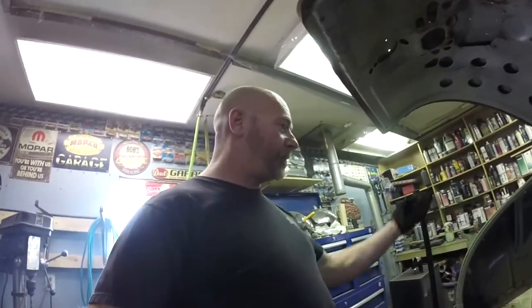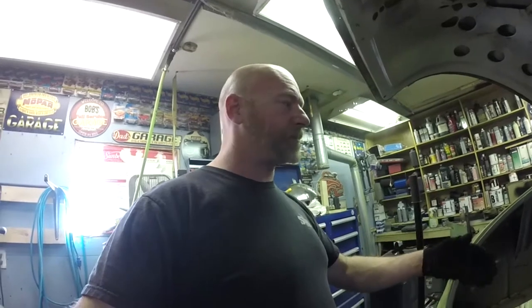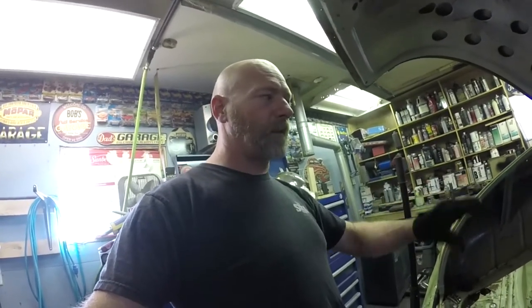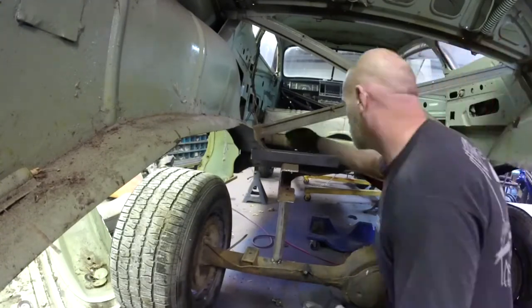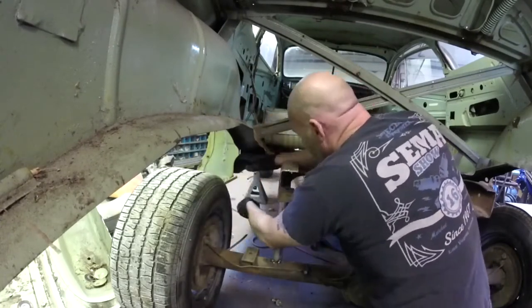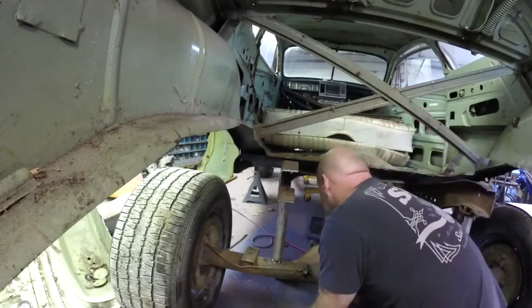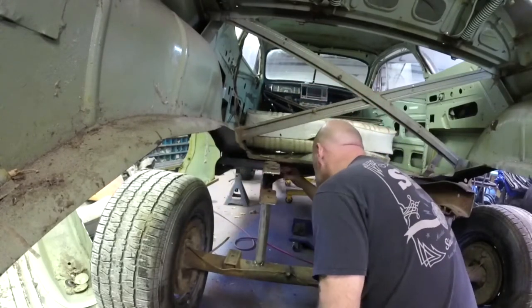So we're going to go ahead, bolt them in place, find the spot on the frame, clean the rust off the frame, and then tack weld them in place solidly so we can leave those and move on to the fronts. And we'll knock the front down, build our mounts across at probably the second one back, and then we can actually get the jack stands out of the way on the front and keep building. We'll be right back.